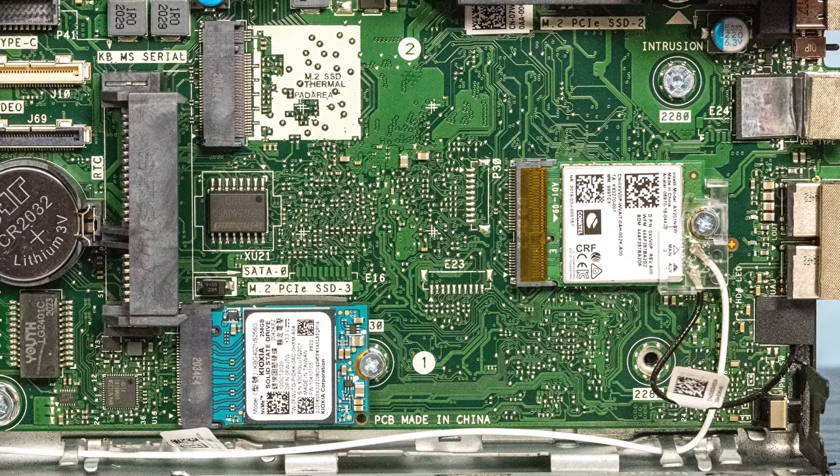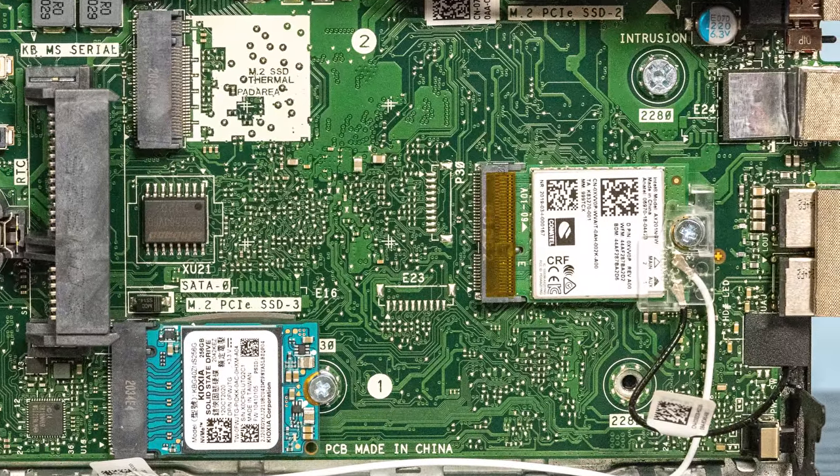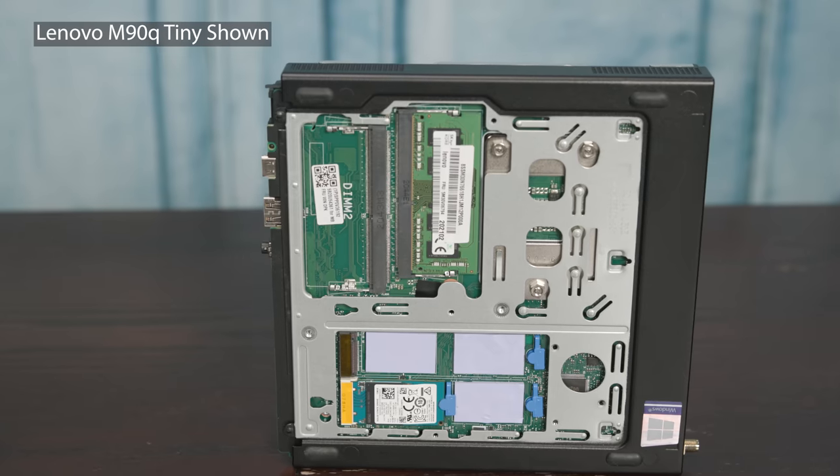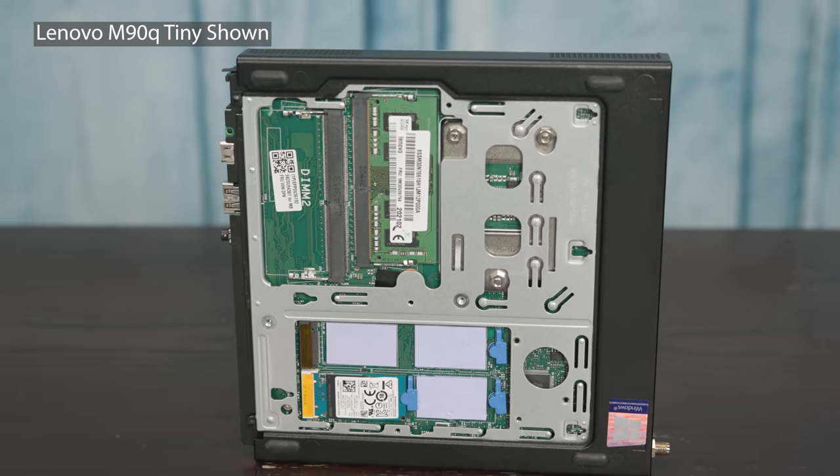The Wi-Fi card is an Intel AX201, which gives us Wi-Fi 6 as well as Bluetooth. In all of these systems, that's an optional feature, but one I basically always configure, and I look for it when buying secondhand — even if you're not sure you'll use it, it's easier and usually less expensive to have it built in than to add it later. There are headers here for the optional port, but we don't have that installed. The first time I saw this Dell solution I thought it was a great design, but after using a lot of Lenovo Tiny systems — which have SODIMMs and NVMe SSDs on the rear with tool-less mounting — I frankly think Lenovo has a better system that Dell should consider adopting.